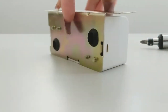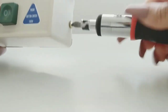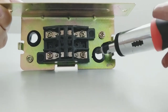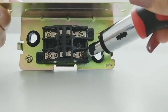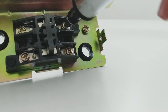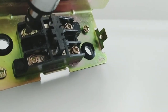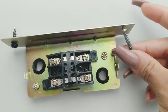This is the switch box that we're going to be installing. On the right side there's a tiny little screw that we're going to be releasing so that we can get inside the box in order to connect the wires. Our main goal is pulling the brown and blue wires through these big holes — we're going to pull the motor wires through the left and the power set of wires through the right. Then these four screws we're going to be loosening so that when we pull those sets of cords — the power and the motor — we connect each one respectively: brown at the top, blue at the bottom.